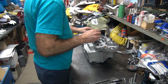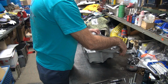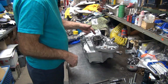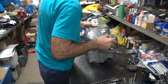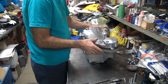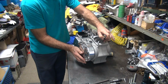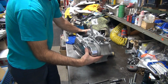Okay. Are you lining up the timing marks too? Yep. Does it make a difference if you don't? Yep. Even at this stage? Yep. Cams are lapped already. Oh, so all the grooves have to line up because they're lapped to fit at that spot? That's where they're lapped to. Oh, neat. It just sucks it right in, huh? She'll suck it right up. That's pretty cool.